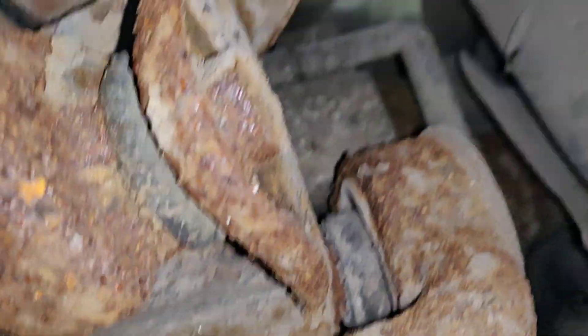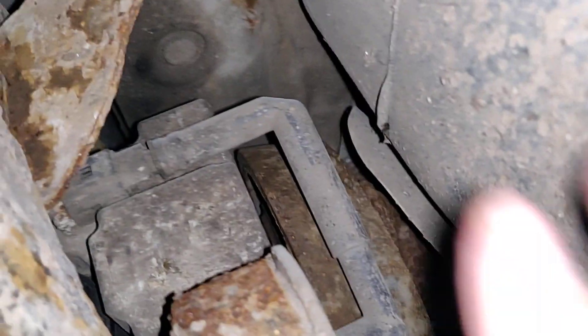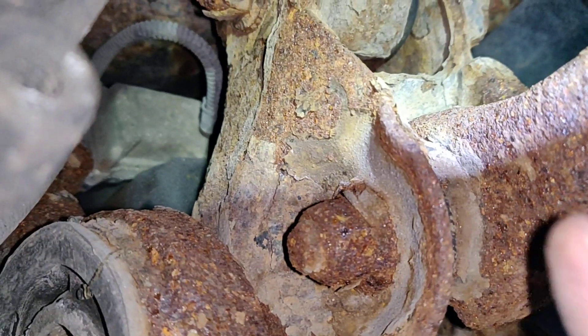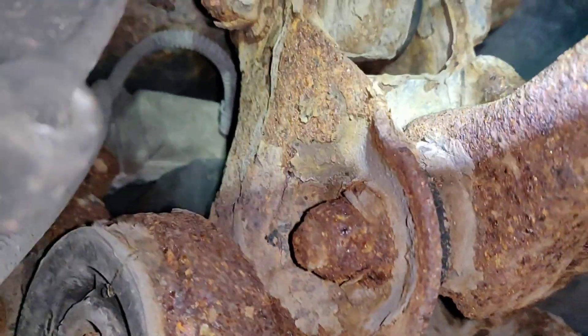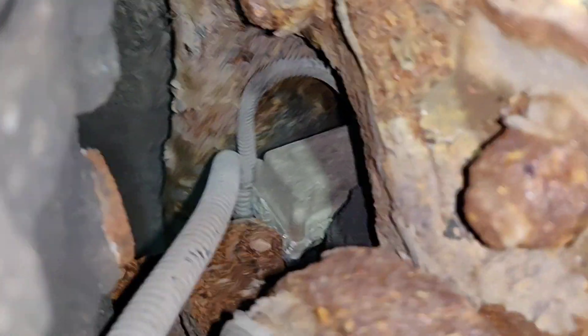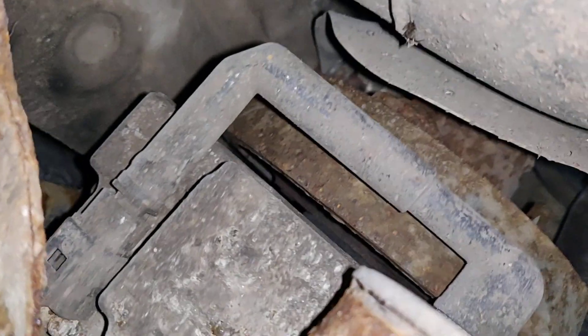Now the thing I've got to change — where is it? There! That's my box. That's the standard Haldex unit. Upper bottom rear control arms — you can just see, just there. That black plastic thing — that's the head of the Haldex oil filter. The Haldex control unit is up there, held on by two bolts: one on the side and one on the top.